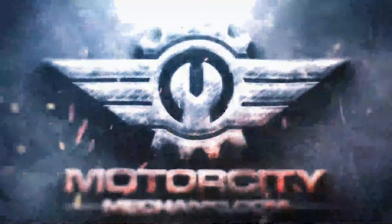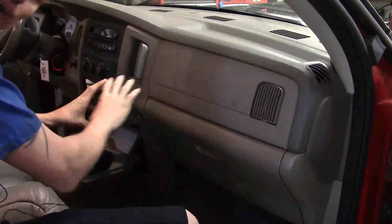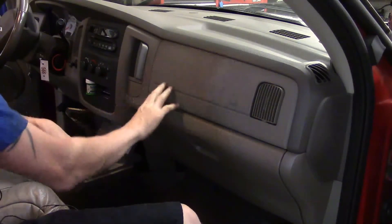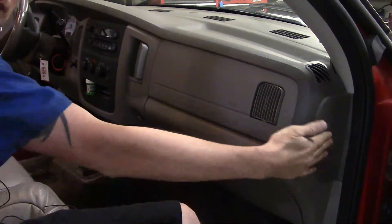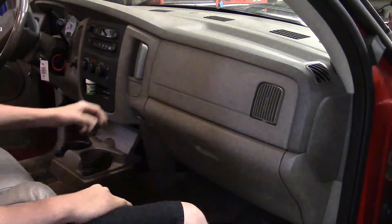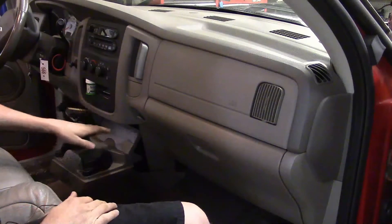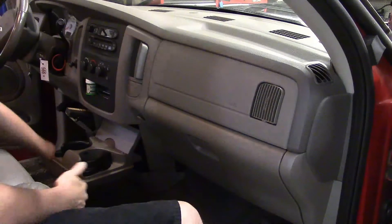The basic process we're going to do in order to get this airbag assembly out — which is mounted directly to the back of this cover — is: take the side panel off, remove the glove box, pull the AC control head radio bezel off the vehicle, and work on getting the cup holder assembly out and the piece of trim going directly below it.